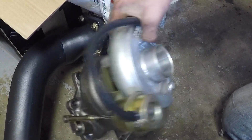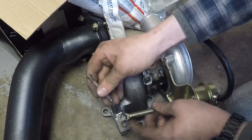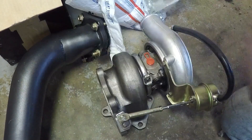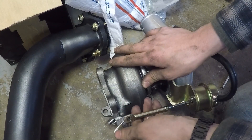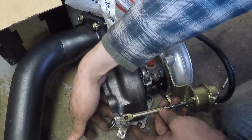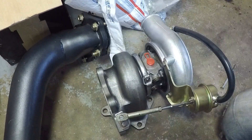This is the turbo I am using on my Subaru — a TD05 turbocharger. There will be a link to where I bought it on eBay in the description. Before we install it on the car, these are preset at 12 psi of boost — a little too much for me, being that I have no engine mods, just a stock engine. So I'm going to tone this down a little bit and make this longer so that the wastegate opens more frequently. That looks good to me — probably about five pounds of boost. That'll do.